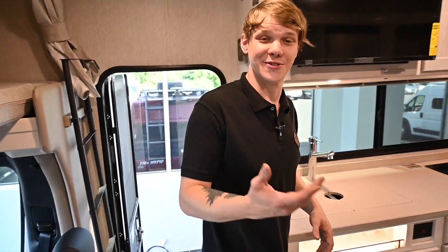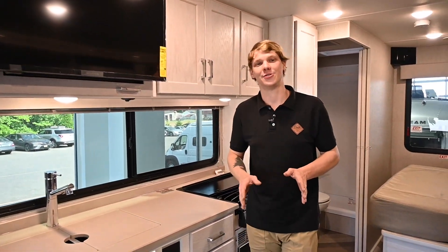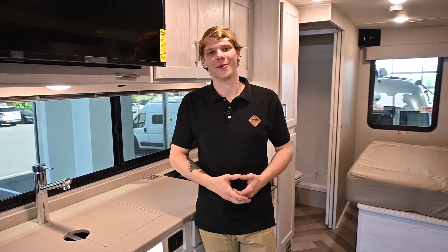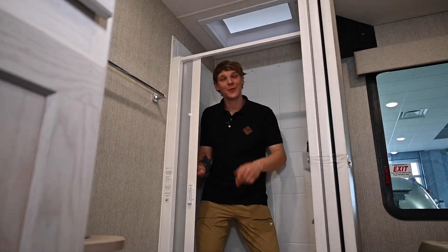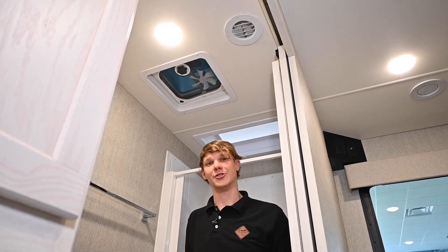Once inside, it's all about balance — maintaining optimum relative humidity, which is a fancy term for air water content. Winnebago recommends that you keep your relative humidity around 60% or lower. For that, you're going to need a hygrometer. You can easily find one online or at a local store, and it will give you an accurate reading so that you can take measures to reduce the humidity. Your Winnebago is equipped with exhaust fans as well as an air conditioning system to help you manage this moisture.